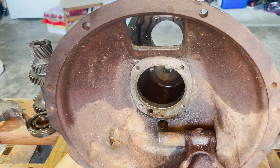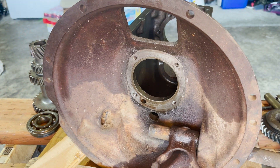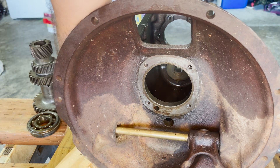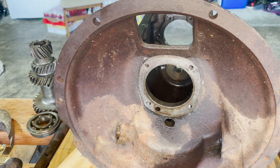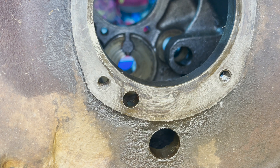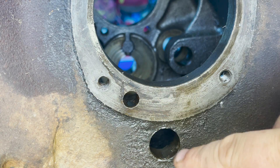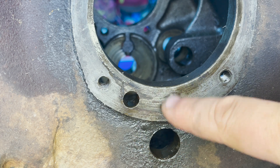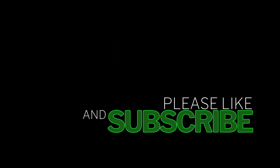I'll clean off some of the gunk that might be causing the problem. Now the fork comes off and the shaft comes out — that can all be cleaned up. I'm looking at those bushings, confirming they're shot and need to be replaced. Some inspections on the housing you should do: at the front end, check to make sure there's not a crack going up into the bearing housing — if there is, get a new transmission housing. Also at the back, check for any excessive wear. Thanks for joining me on this disassembly — we'll see you next time, take care.